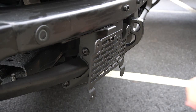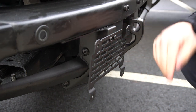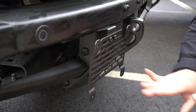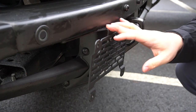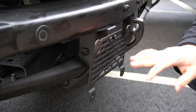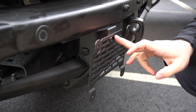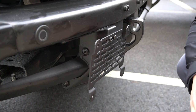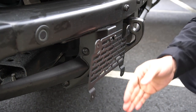Since I've already got this installed on our shop truck, I'm going to give you a quick overview before I pull it off and we step through the installation. Your kit comes with a backing plate like this regardless of which bumper you have, and then you have a bracket that mounts it to the bumper. This is the bracket for the mod bumper — the bracket for the plastic bumper is slightly different. The mounting plate mounts to this bracket using two button head machine screws, and both brackets have permanently installed threaded inserts so there are no nuts involved.